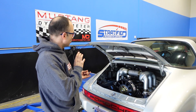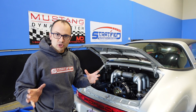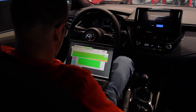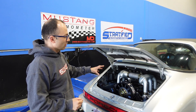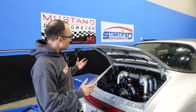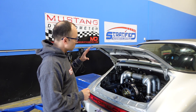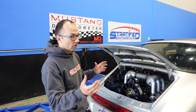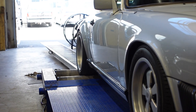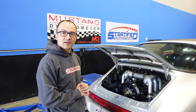The whole system has been modernized, which will improve both performance and drivability. But before you get those improvements, these cars need to be tuned. On our channel you see a lot of tuning on modern cars where drivability is already dialed in by the OEM. On this car you start at a more basic level — set up all the electronics, sensors, and actuators, then tune the drivability. Believe it or not, drivability takes longer to tune than outright power. This engine is fresh, so we're doing an initial drivability tune now, the owner will drive it to break in the motor, and then we'll do a final power tune. All electronics are driven by an M800 Motec ECU.